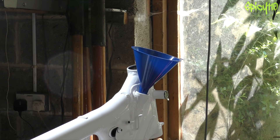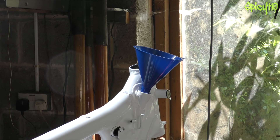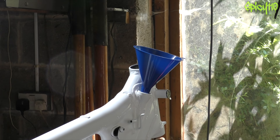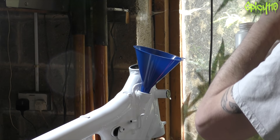There are all sorts of things you can use: specialized oil tank flushes, engine flushes, diesel, petrol, tons of brake cleaner. Paraffin — kerosene — seems to be the common suggestion, and I use it for degreasing. My only concern is what's left over afterwards, but I'm going to rinse it all out with brake cleaner and blow it through with an airline and let it dry, so it should be fine.